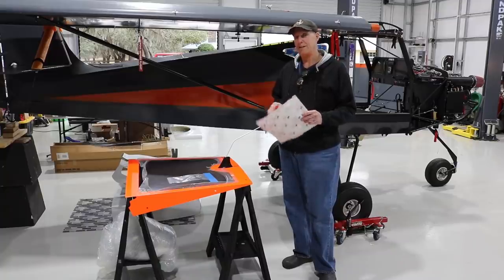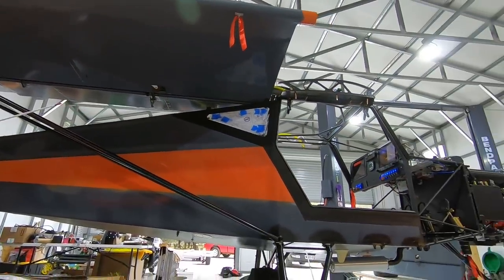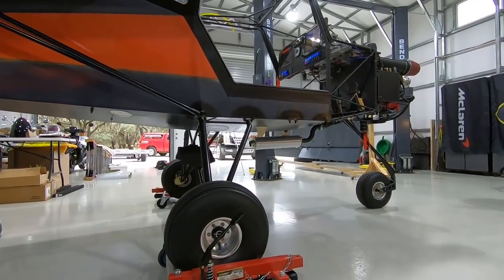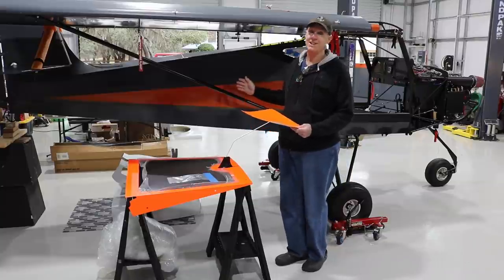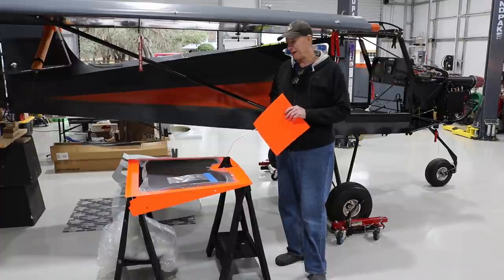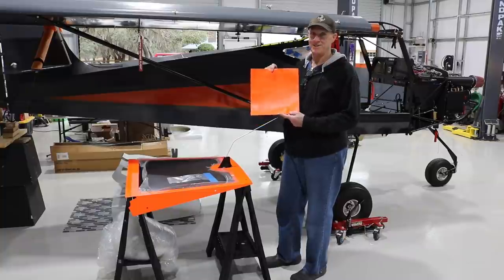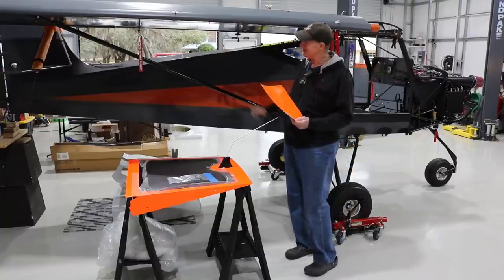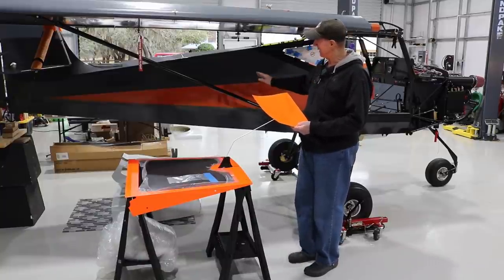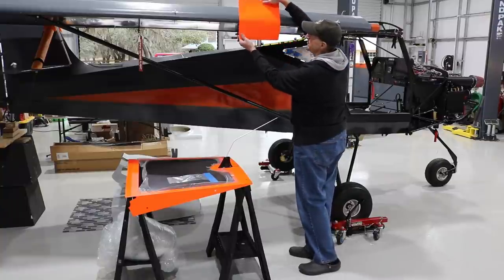What color scheme are you going to do? I'm not repainting anything — there will be no paint on this plane. I'll sand out where the paint overlaps and get it smooth with 320 wet-dry, and then I'm going to wrap the entire airplane. It's the future. If I don't like it I can change it, and I'm not going to spend $10,000–$12,000 to paint it when I can spend $2,000–$3,000 to wrap it. I wanted an in-your-face color, so this is going to be a tri-color scheme — super bright orange on the turtle deck sweeping up into the tail, gray on the bottom, and a black stripe separating the two. If you take this out in the sun it actually burns your retinas, that's how bright it is.